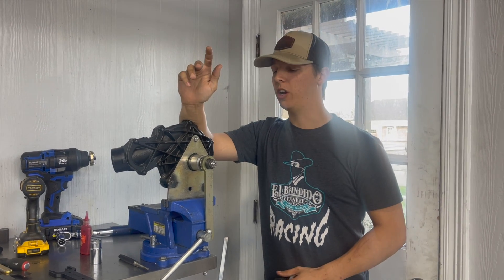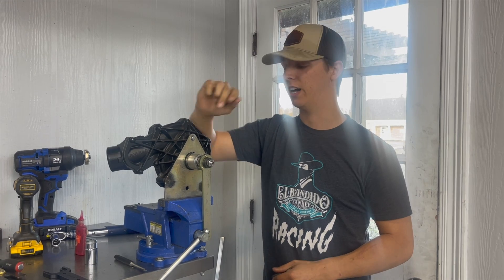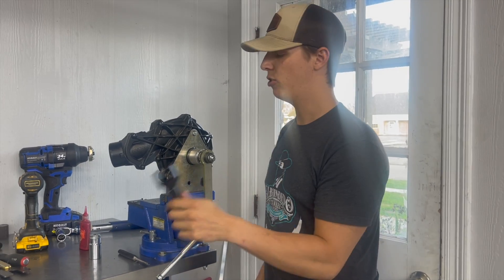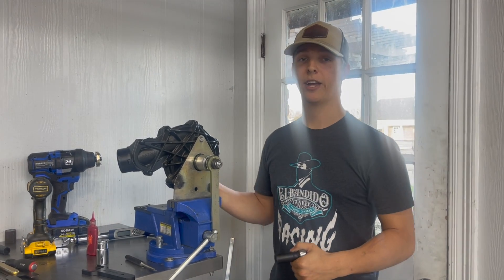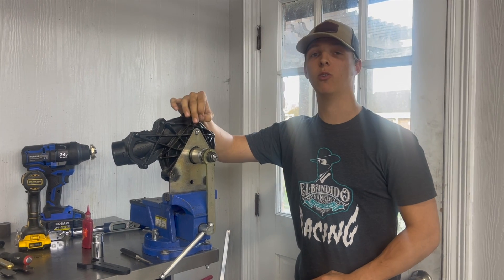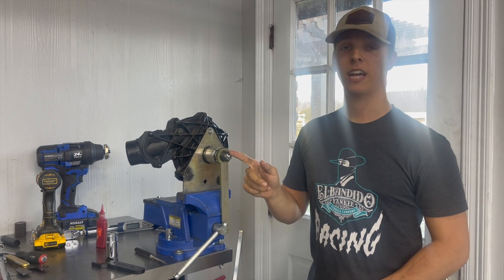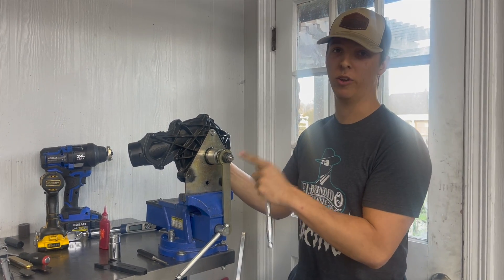On this one we're going to set the slip to 18 foot-pounds. Setting the slip on these 300s is very difficult and tricky, but I've done so many I've got a system that works first time every time. To do this right you're going to need a few specialty tools: a mounting plate for your supercharger, a gear holding tool, a shaft holding tool, and a digital torque wrench. If you use a standard click-type torque wrench it's not going to be accurate — what you think your slip is won't actually be your slip. The trick I've learned is to initially set the slip 1.5 pounds less than your desired final value. When you torque down the lock nut it's going to be perfect every single time. So we'll set the slip to about 16.5 foot-pounds and when we come back and put the lock nut on it's going to be right at 18.